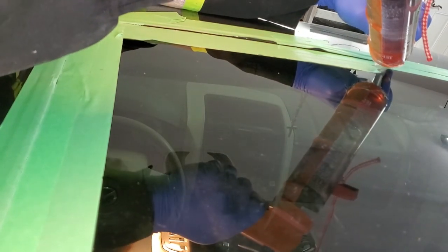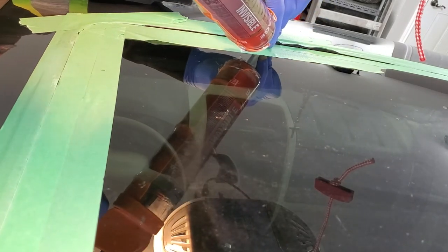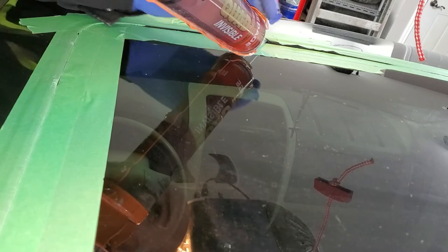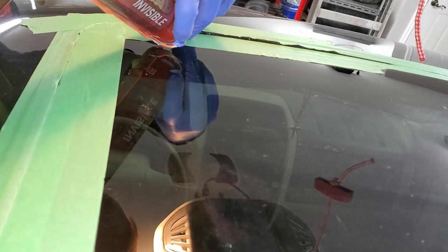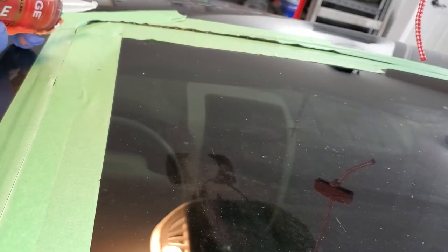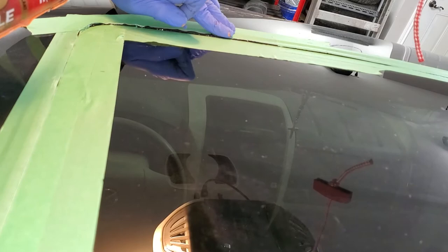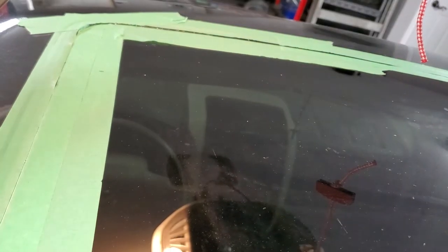You need to hold the nozzle and get it under the seal. Ideally you want to see some silicone coming out, and that's what is happening right now. If I press the seal down, silicone comes out — and that's what we need. We then just press it tight. There is silicone coming out and that's exactly what we're after. We'll do this for the rest of the seal.